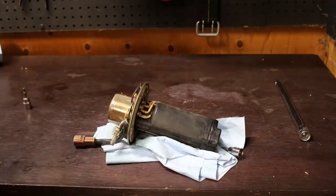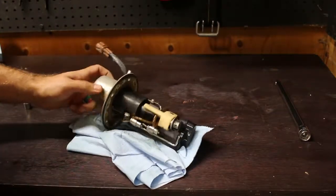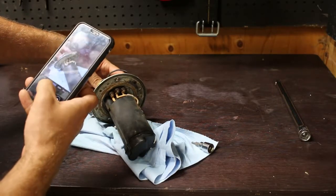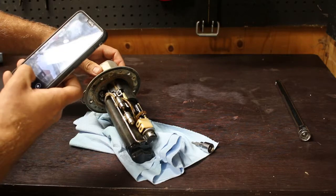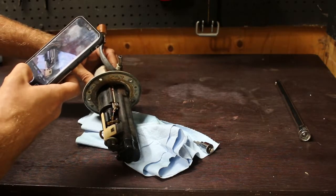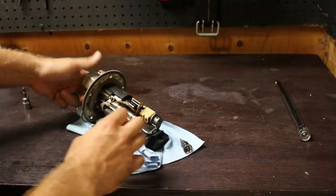While I'm waiting for the vinegar to do its thing, I thought I would come over here and start taking this pump apart. Get a rag ready — there is gonna be fuel left in the pump. I've never done this before, so I'm going to take a picture of this for my own reference in case I can't get her back together, and I suggest you do too. She looks complicated. There are three wires here — I'll label those. There's a Phillips nut that holds this bracket to that bracket, and there's another little Allen right there. It's got a power cord — I imagine it's a ground — bonding this ground to the pump inside.